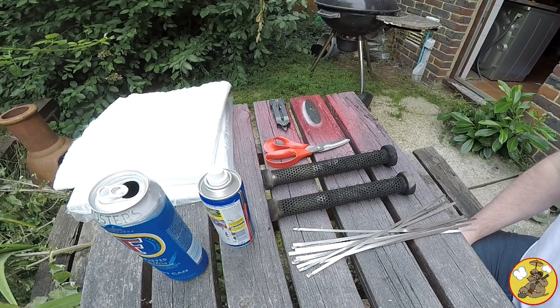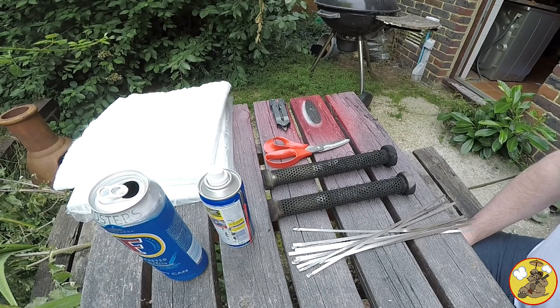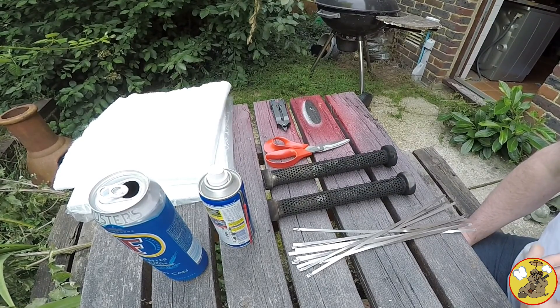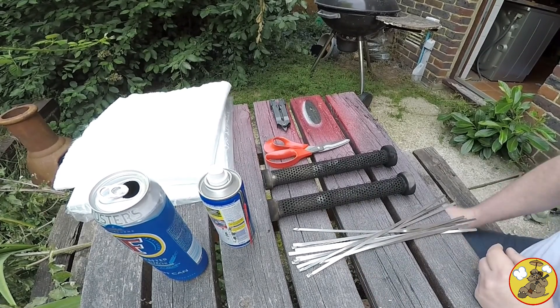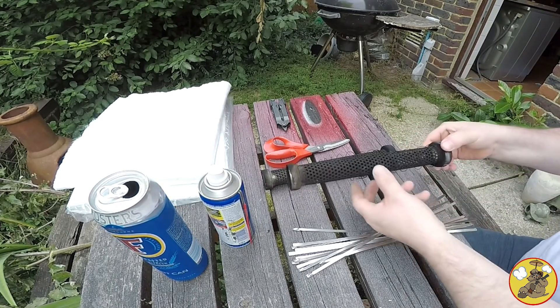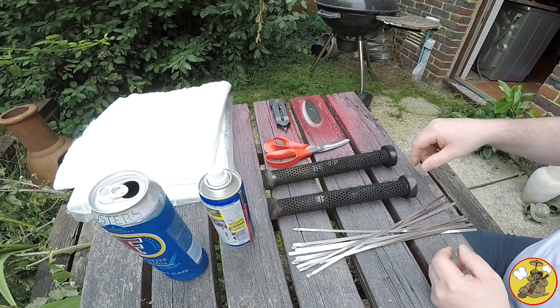Good afternoon ladies and gents. You might recall from my last video that I was saying that the baffles that come with the new cans — I wasn't able to fit them and they didn't have much in the way of packing on them. So I took a look at the state of the baffles on the cans I've got fitted and as you can see, there's no packing — it's all burnt off and gone. Which means they were effectively rather noisy. You can see the wiring on here still managed to stay wound on there, but all the packing's just got burnt off.